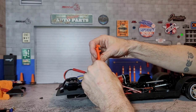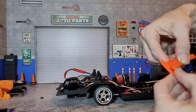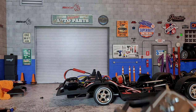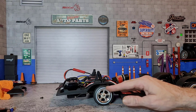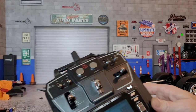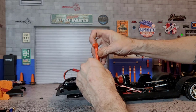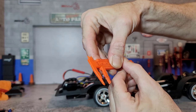And this one here, it is 7 millimeters. We're gonna bring this up to 9 for both of them. So I wanna make this 9 millimeters when sitting down. I understand I wanna raise it, but because we're reducing how low it's sitting, we're going down on the number. So going down on the number is gonna raise the suspension. I know it's a little confusing. All right, so we wanna get this to 9 millimeters. And we still got some ways to go.